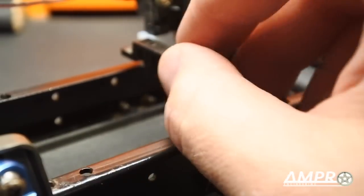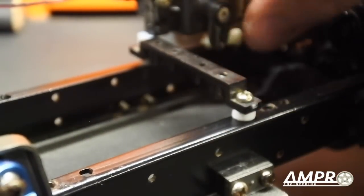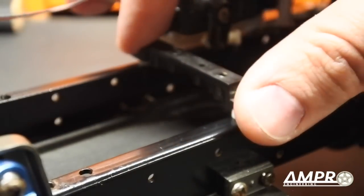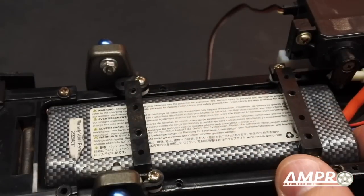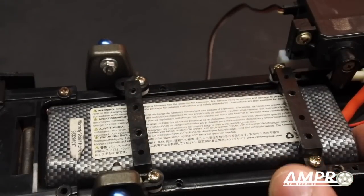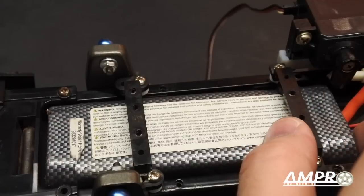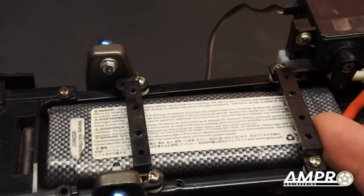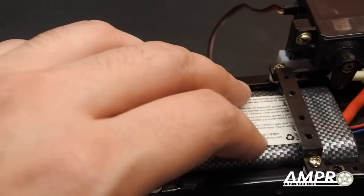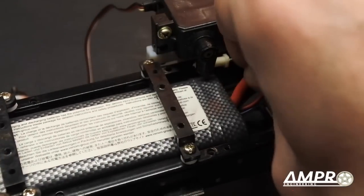Be careful — you don't want to put it into this hole here because when you pull this servo arm back it's possible it could come into contact. Both braces have been installed and there is just a little bit of play in the battery. I might put a little dab of foam in here to prevent any vibration or rubbing on the soft pack of the lipo — probably not a good idea to allow vibration to cut through the plastic on a lithium polymer battery.